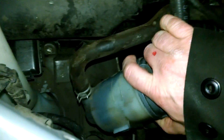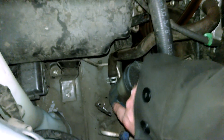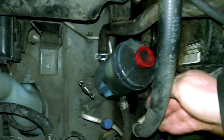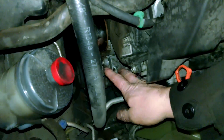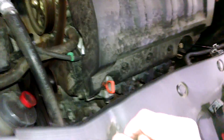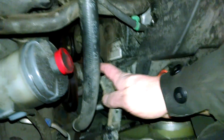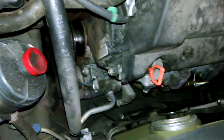Getting it out — I lifted this up and out. It sits on a little bracket down here. There's a bracket for the washer fluid — sorry, antifreeze — right here. Lift that up and out; it's just slotted. I lifted the power steering reservoir up over the AC hose as much as possible, which gave me freedom to get the alternator out through here and up and out. A 12mm bolt holds the bracket on the engine, another 12mm bolt for the alternator, and a 14mm bolt goes through the eyelet — so two bolts hold the alternator in place.